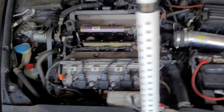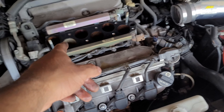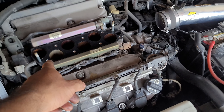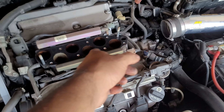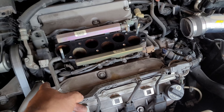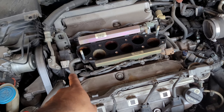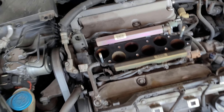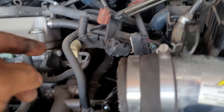Alright, so we got it out pretty easy. Now we got to get these out — these are the runners. We have to replace a few eights in there, pop the fuel line, this little power steering — I think to get in there right the bracket you got to move it, but we'll take a crack at it. Just anticipate coolant leaking.